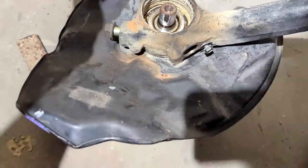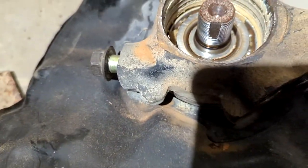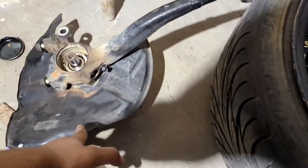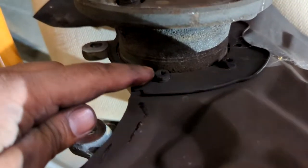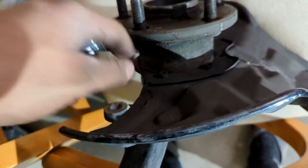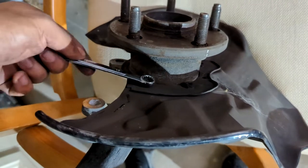Now there's the bearing. I don't think this bearing is bad, but at the same time it doesn't exactly look healthy, if you know what I mean. I'm going to replace it anyway. Besides, I've got to push the hub assembly on to get this dust shield off. If you look right there, these are Torx head bolts — I thought there was going to be no way for me to pop a Torx head in there and loosen the dust shield. Turns out I'm kind of dumb — it's just a 10mm bolt.